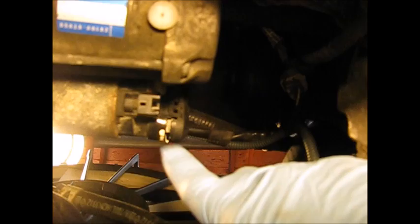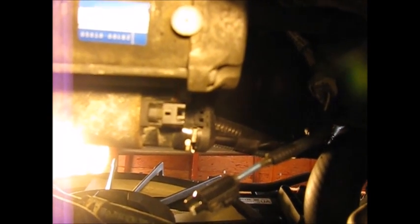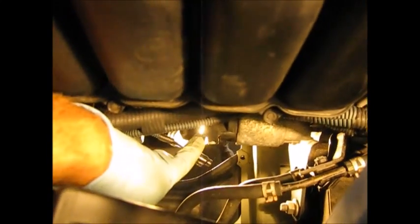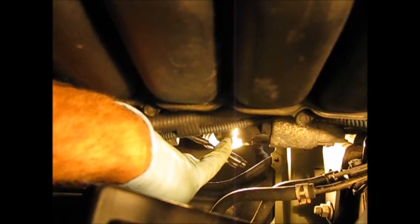And now there's a little cap that's on the B+. I like the rubber ones better. I'm going to have to get the other half of this cap off from the top. Of course, we've still got the lower bolt of the starter bolted in, so we can turn out the B plus nut. So the other there. So now we've got, wow, there's like a third one. Okay, now we've got this B plus bolt exposed. Got the little protective boot off of it.